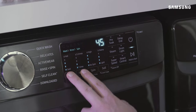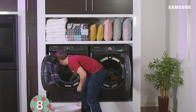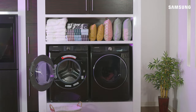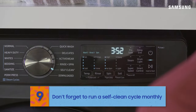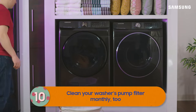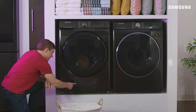After the cycle, keep in mind that the inside of your washer will be a bit damp. To prevent mildew, it's a good idea to keep the door open for a while. To keep your washer happy, run a self-clean cycle once a month or so to clear gunk from the main drum — don't ignore the indicator light, or it'll wait another interval before reminding you again, giving your washer time to smell funky. Your front load washer will also have a pump filter, usually located here — it's a good idea to clean this out monthly too.